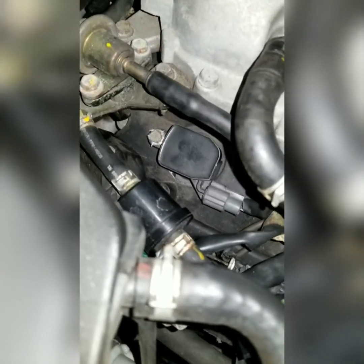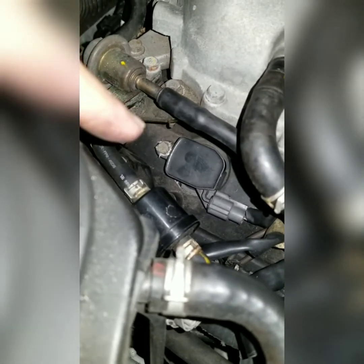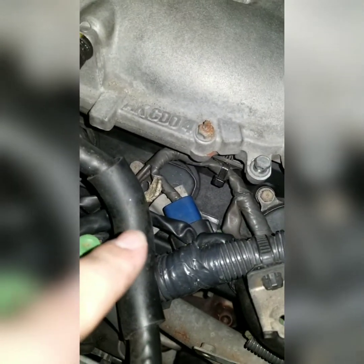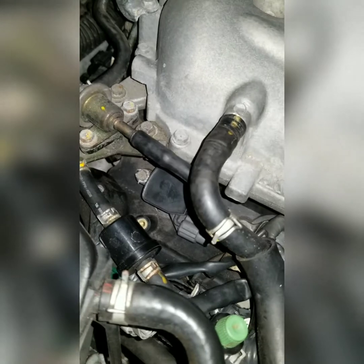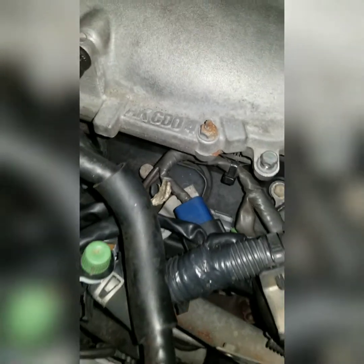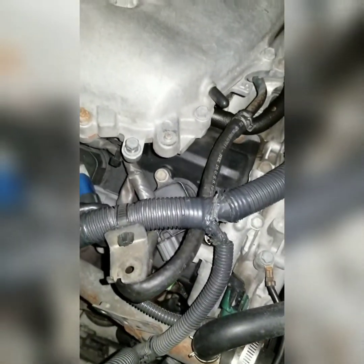If you want to determine whether it's a spark plug or not, and this is if you have a coil pack system, you would take off this coil pack here. You can put it on any other spark plug coil pack that you want to. Then you would also take out that spark plug, and select any spark plug other than the one you put your coil pack onto, and change it out with one that's not reading any misfiring codes. So if I took the spark plug out of this one, placed it in this spark plug here, and put this spark plug into that one, and we were having a misfire for cylinder number, this one would be 3, then you would realize it would be a spark plug and not the coil pack. So I am going to run down to the nearest auto parts store and get it changed out.